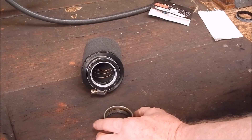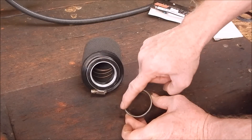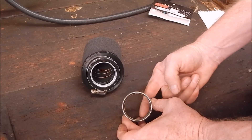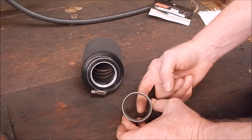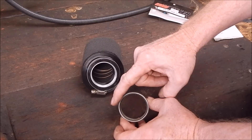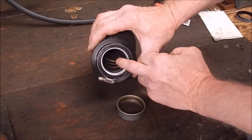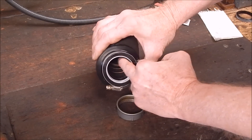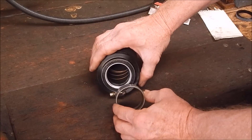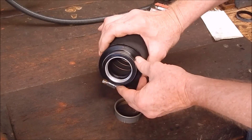What we've got is the original orifice entrance to the little ram tube is 48mm wide, reducing to 47mm where it goes up against the face of the carby. But before that happens, the air has to come through only 42mm — the hole in the UniFilter — and then open out to 48mm. So you're restricting the airflow enormously with this type of arrangement.